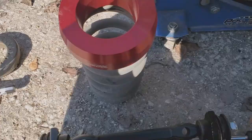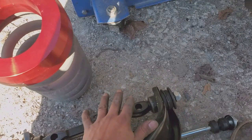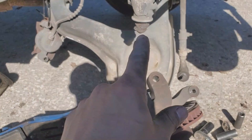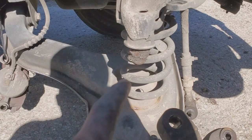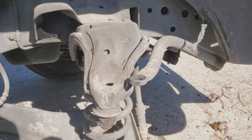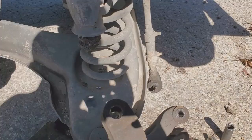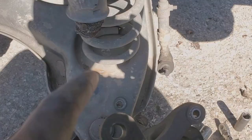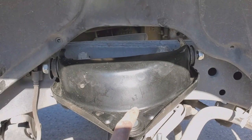On the new control arm you're going to be able to spin it around — leave it like that until we're ready to tighten everything up. When you put this inside, hopefully there is enough space. It was enough room for me to put the leveling kit without raising the truck more. Make sure you put the rubber piece in there and get it lined up. Now I'm going to keep jacking up the truck, and while I'm doing that I'm also going to install the sway bar link from underneath — don't forget to do the sway bar link now or you'll have more trouble later.